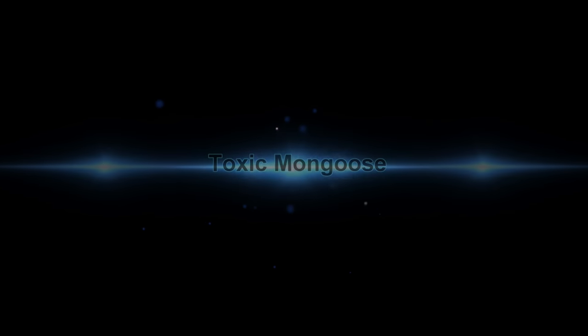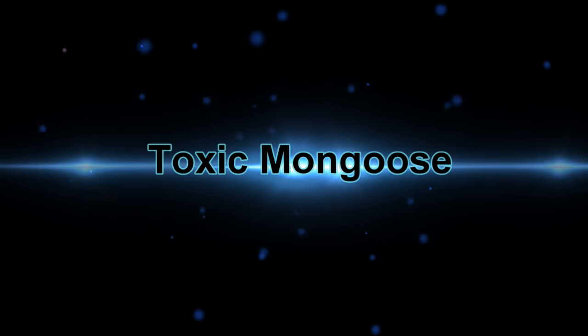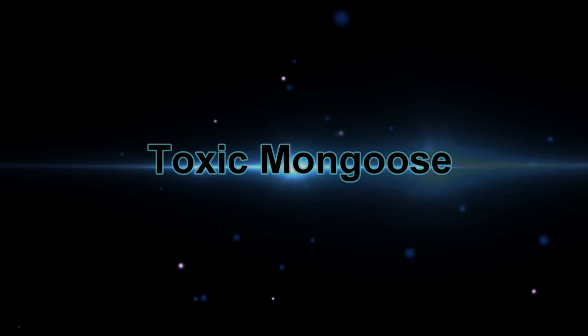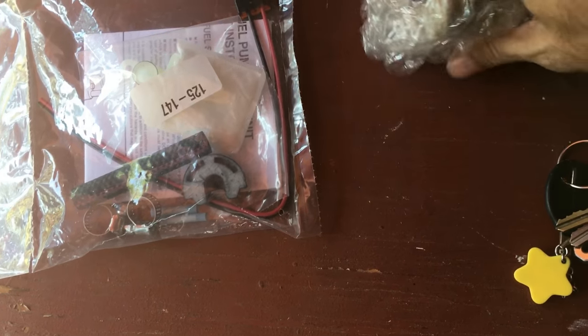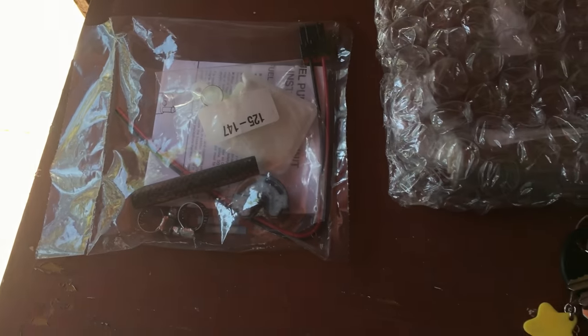Today, we're putting the Walbro 255 in the 240 SX. The stock fuel pump for the 240 SX will not be enough for, well, putting the LS in. So, you gotta upgrade the pump. I have a Walbro 255 and their accessory kit.